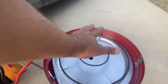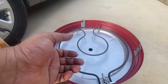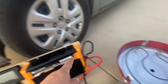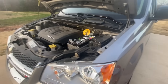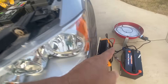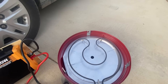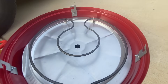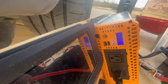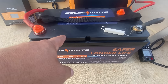This is not going to give me any more issues in the future — once these heating elements get seasoned enough times it gets easier to start. The very first couple of times I tried this with the car, before I had the Golden Mate, I had to rev up the engine to keep the inverter from going into low voltage mode. The more you use it, the less resistance it has. You can actually see a reddish glow to this. Voltage is at 11.45, 153 amps out — this is an amazing battery.